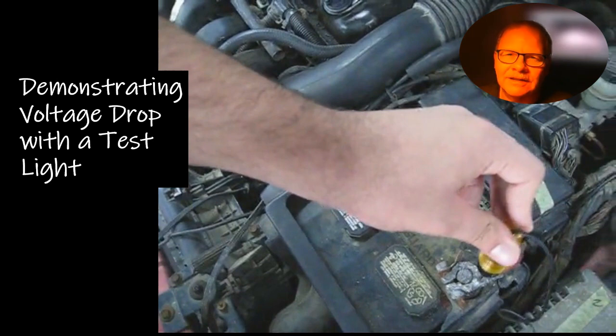This was on a trainer vehicle, the Dodge Neon — whenever I ran into something like this I would show it to students. Another bug I liked to plant on that Neon was disconnecting the ground wire connected to the body right in front of the battery and pulling it back out of sight. Whenever you did that the car wouldn't start and the wipers would run all the time. It was great fun getting them to chase that kind of problem.